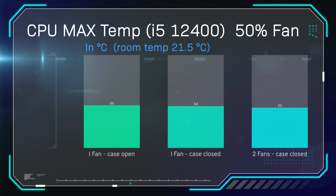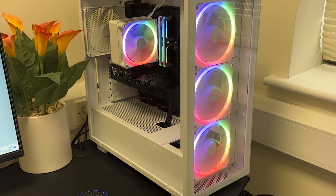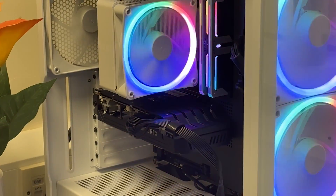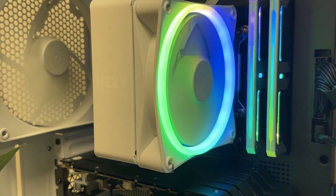Adding an extra fan — I wouldn't say it's pointless but it's not far off. We also tested sound levels, measuring above the room decibel level. With just one fan on the CPU cooler and an open case, you're looking at around 6 decibels above room level. With a closed case running three front fans, one rear fan, and the CPU cooler fan, you're getting 9 decibels above room. Adding the second fan to the cooler with the case closed gets you 11 decibels above room. The case fans on the NZXT H7 Elite are honestly louder than the cooler fan itself, and the H7 Elite can get a little noisy when fans are set to 100%.